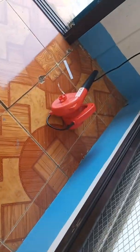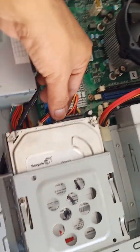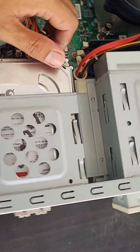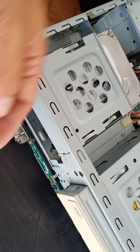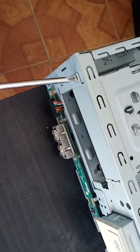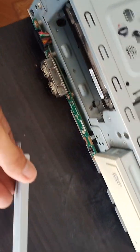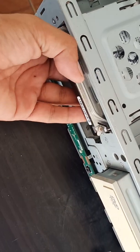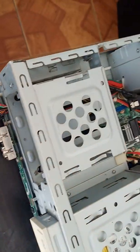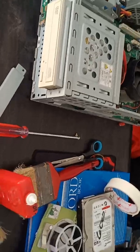Pull the SATA cable and the power cable. You can see the lock here — unscrew it and remove the cover, then pull the hard disk drive out. After that, we proceed to use the blower to remove the dust.